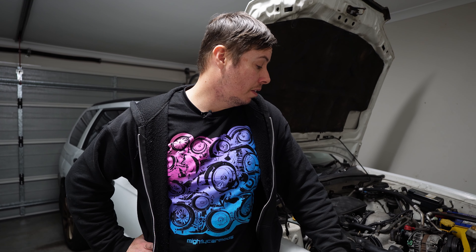Even after cleaning out the throttle body, which was quite carboned up, there still seems to be another issue with the car revving up high. With the old plugs it didn't used to do that — that's probably mostly due to the misfire. I'm just hoping it's nothing major; hopefully it's a wiring issue, but we'll dive deeper into it in the next video. Thanks for watching and sticking around — if you've enjoyed this and liked it, please subscribe and hit the notification bell so you get notified when new videos come out. I'll see you in the next one when we tackle the further issues that this hunk of crap has.